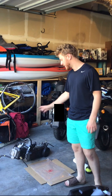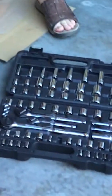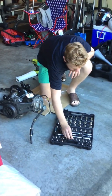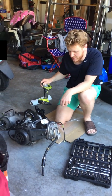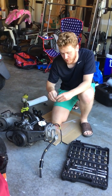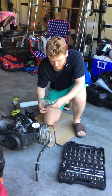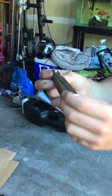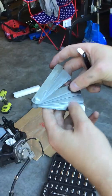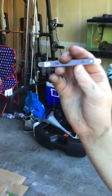This is a super simple engine and we're going to be doing the valve adjustment with it outside of the bike. What you're going to need is really simple: a socket wrench kit — you need a full kit. This is the 8mm right here that you're going to need. No power tools. The other thing you're going to need, apart from some paper towels which are useful because you're going to get some oil dripping, is a feeler gauge — .004 and .005. You can get them in a set, but these are all too big. Get one specifically for GY6 engines, like this one I got off Amazon.